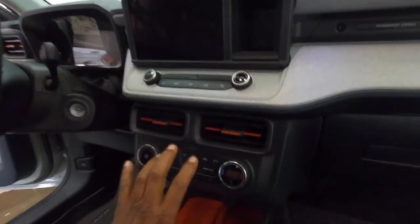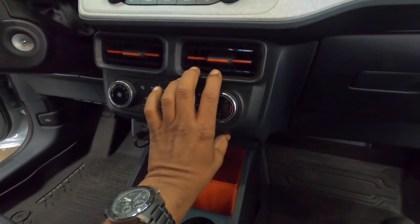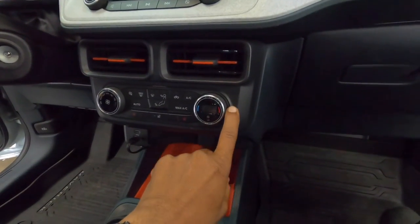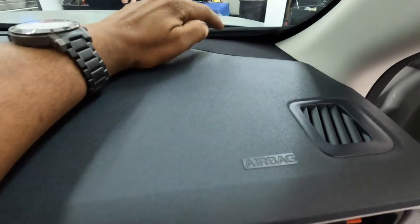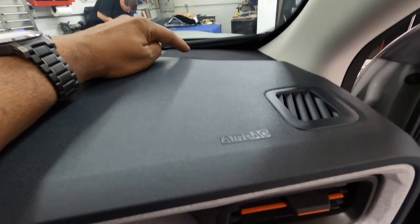This is the wrap-up video for the 2022/2023 Ford Maverick hybrid. The screen is the dash — all the guts are here. When upgrading the system, all connections are made here because the tuner is behind this piece. We redid the grill up here because the tweeter hole is only about 20 to 25 millimeters maximum, so we widened it out.